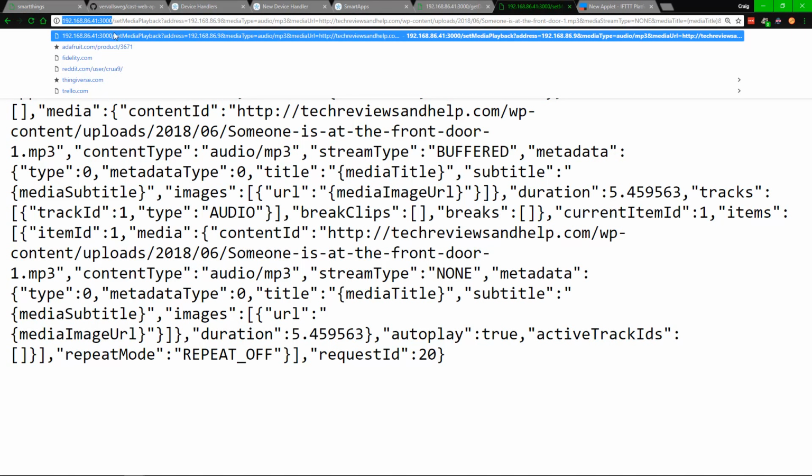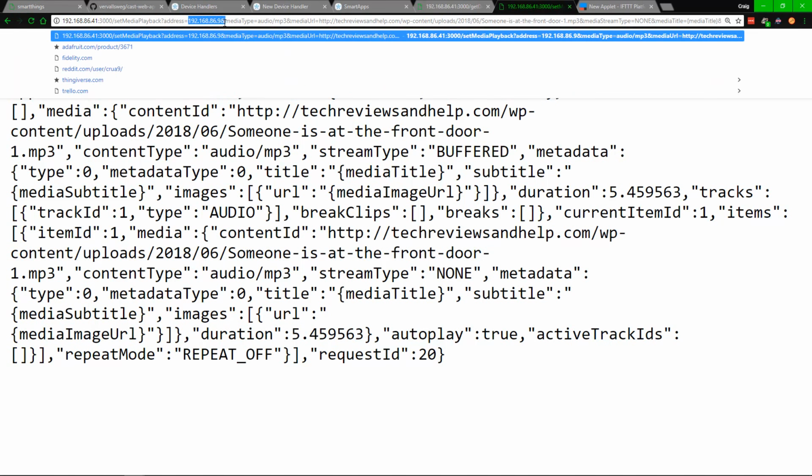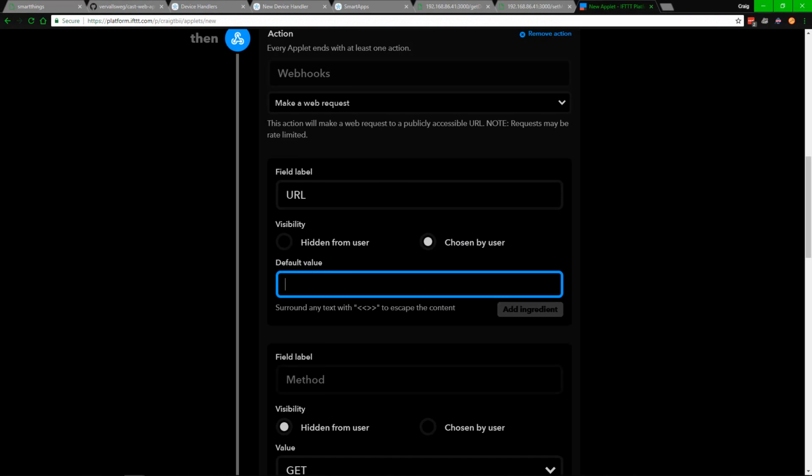So like this very front part, what I'll put is a dynamic DNS address and the port it'll be going to for the port forwarding. What that says is I want to go to my personal address, and then, however I have the port forwarding set up, go to this specific address with the port on this particular network. So note that. Also note the IP address for the device itself.